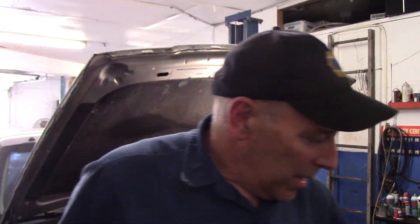Let's go up underneath the hood and continue there. If you have a test light, use a test light. If you don't, I always use the power probe because you can check power and ground at the same time. We're going to connect these up to the battery and then go down underneath the car by the starter motor while my assistant tries to start it. We're going to see if we have power to the main lead and also power to the start wire. If we have power and ground and power to the start wire and it's not starting, the starter is no good. If we don't have power to the start wire, then we know there's a problem with the starter switch or relay.